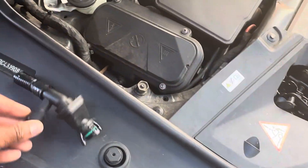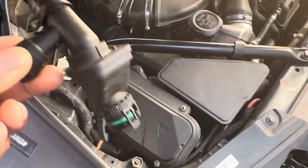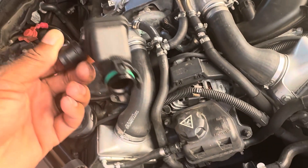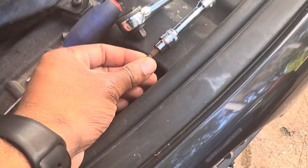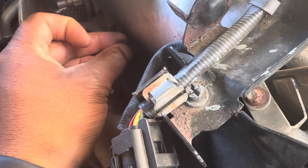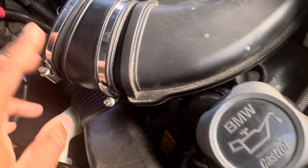I do have a replacement and this is actually a replacement I already put up there. As you see, it looks kind of brand new, and then this one is more older — doesn't have any writing on it. So I went to order another one. You will need a T30 to take the bolts off. The bolts go right here and there's another bolt that goes right here, so it should be two bolts. I had to use this on the rear side one to get that off.